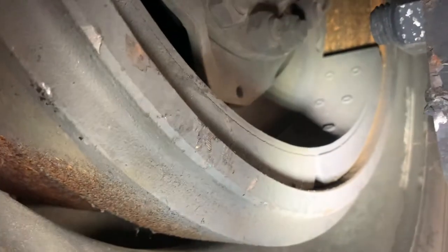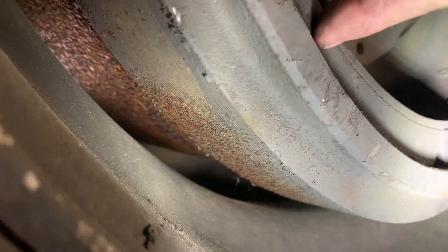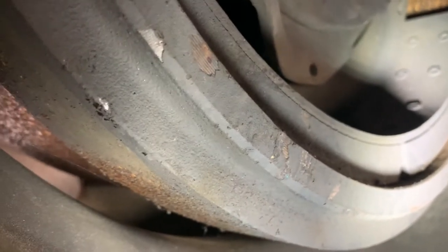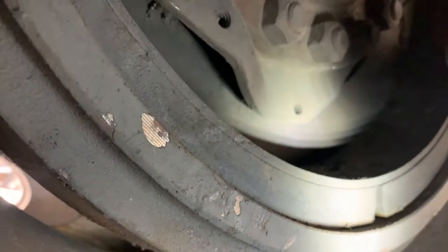Then I came back here and got to this specific spot and took an engineer hammer — or any kind of heavy hammer. You can actually see the marks here where I hit the drum. I did not hit the shoe. I just hit the drum and tapped it probably four, five, six times. With the parking brake off, the spring mechanism actually retracts it up. There's a clip of the spring back up there and it pulls that shoe away. So if you have it disengaged and it's just sticking, the spring is helping it and you just hit it and it pops.